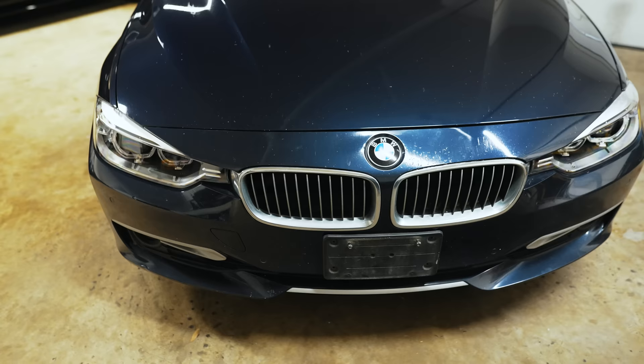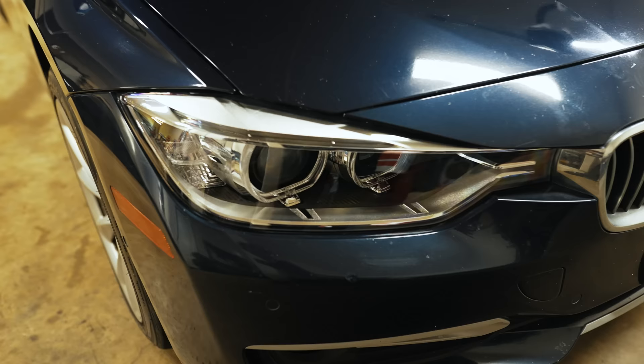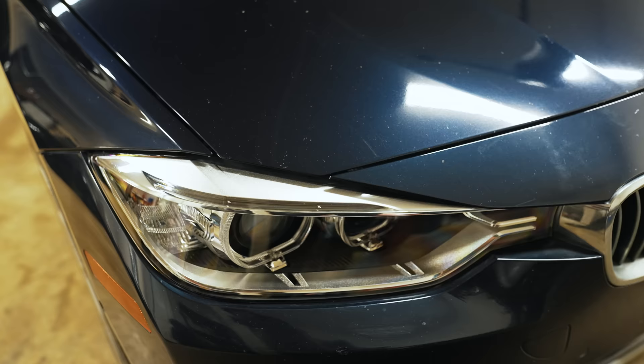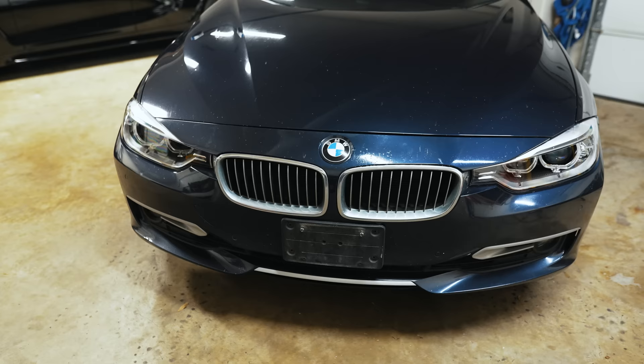If you're interested in these lenses, I'll put a link in the description — you can get them for about $50 to your door. The glue I used is about $15 or $20, so for about $60 or $70 you can completely restore your headlights on an F30 or even other BMWs. Specifically on the F30, the Xenon and Halogen share the same lens, which really helps with the cost — the LED ones will be different. That'll conclude this video on how to replace your headlight lenses on an F30 BMW. Please consider subscribing, and if you liked the video, give it a like — it'll help me rank higher. Thanks for watching.